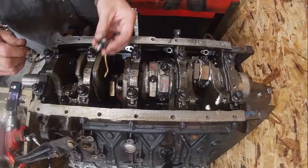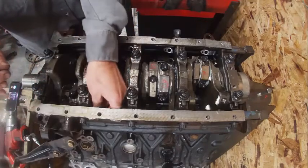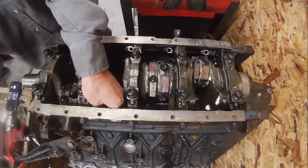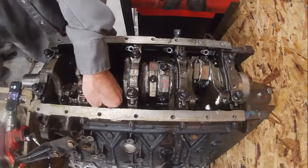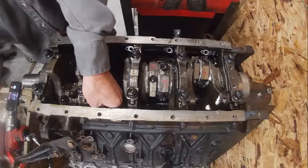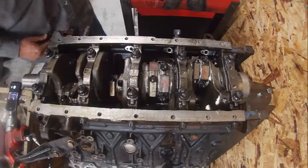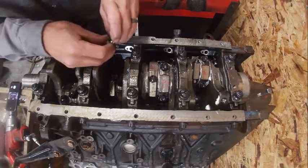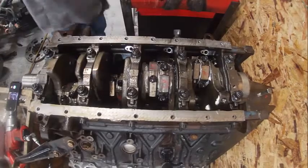The easiest way to get these on is to move your piston to top dead center. Basically, you're trying to get the crank weights out of the way, and then it goes in here like so. They're kind of tight to get in — these blocks are pretty small; the bigger engines are a lot easier. The biggest thing is to make sure it's hitting correctly on the piston. If it's mis-aimed or bent — and I can't stress this enough — when you take an engine apart and pull the pistons, you always want to pull these cooling nozzles out first because you run the risk of bending them if you don't.